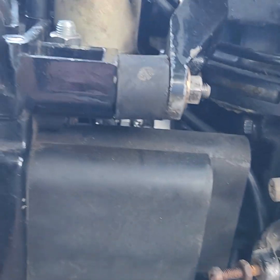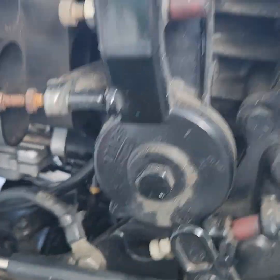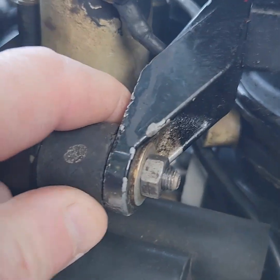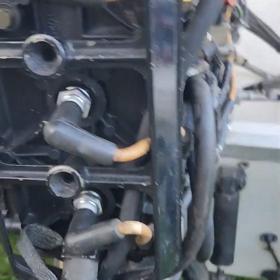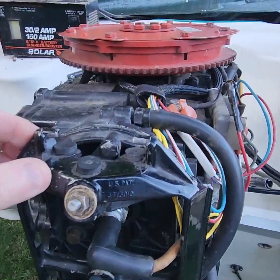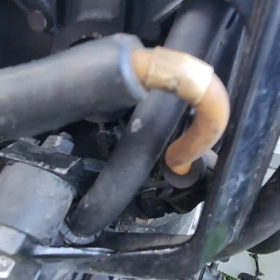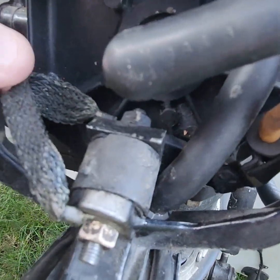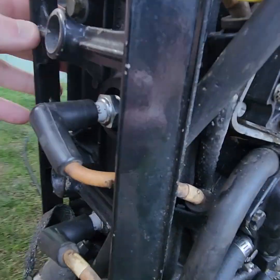Compression is still good, so that's awesome — hasn't melted the pistons out of it. Other things to look for are these old round rubber mounts. This is what holds the cover on back here. It's got a bad mount here and the mount on the bottom looks like that's separated too. So it's nothing special, but it just makes the cover wiggle around.